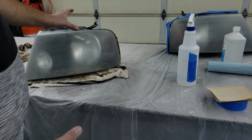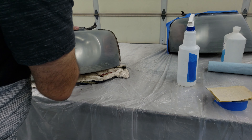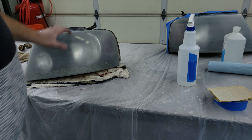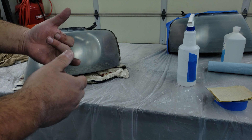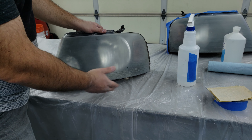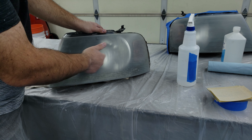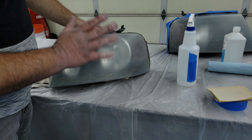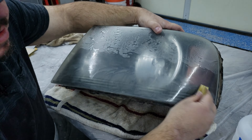As you can see, I've already done some work on both of these headlights. Unfortunately, I had some issues with my phone while I was filming the actual sanding down of these two. But even after doing a round of sanding, this one here is still a little bit junky down here at the bottom. So I am going to do some aggressive sanding down here to see if I can't take care of some of this stuff. I'm going to use 220 grit to try to take out some of this. If I can't get it, it's not a big deal — it's just this bottom part of the headlight, and the other one doesn't really have as much of that problem. So I'm going to go start over, basically, with this one, and I'll walk you through what I'm going to do.